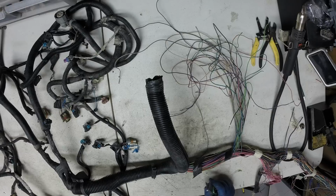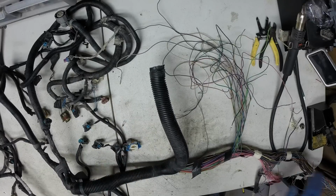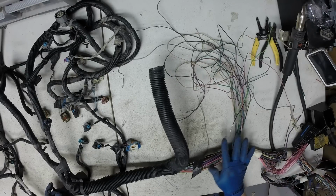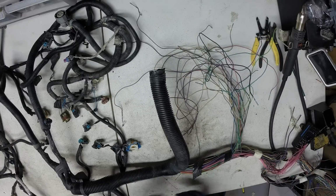Okay, part 2 of this. I've slid the harness down on the table some. This is pretty much where the fuse block connector is. I'm going to leave that there for now. Tag module lead, and everything we're doing is going to be working this direction. We're going to be taking out these wires we've removed from the computer and the C2 fuse plug and the other connectors.